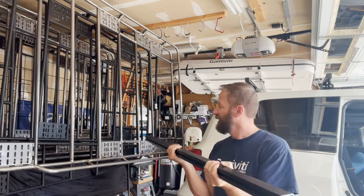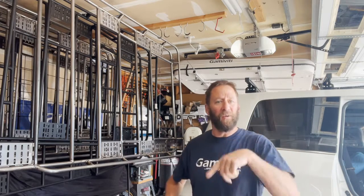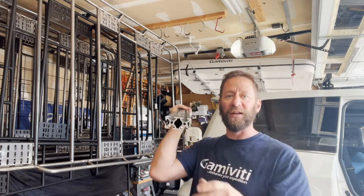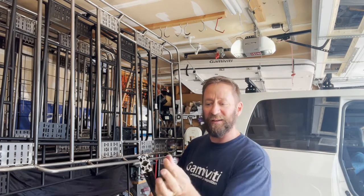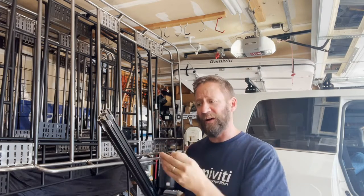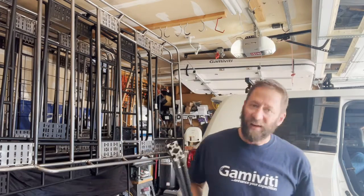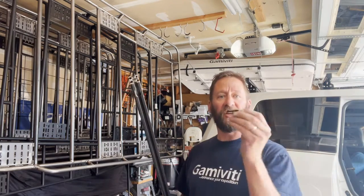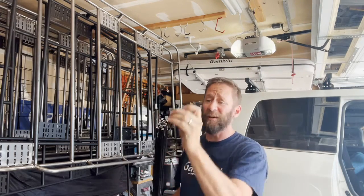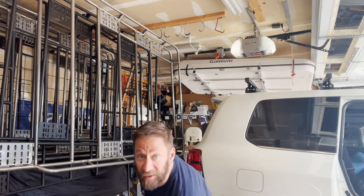I really don't like to use the tracks for accessories — I prefer to strap and clamp things as they're designed. You might ask why go different, why not use what everyone else is using — the one-by-two profile you see on pretty much every other extrusion rack. Part of it is wanting to be different, but honestly I just can't get behind the little quarter-20 track nuts. They're tough to get right — hard to find the right combination of washers so it's tight but not burying the bolt into the track.